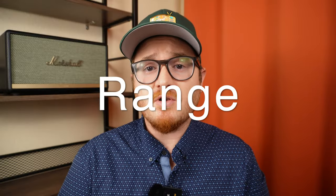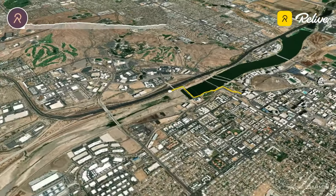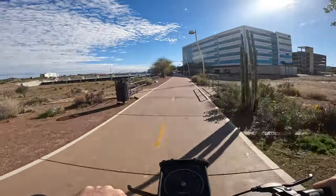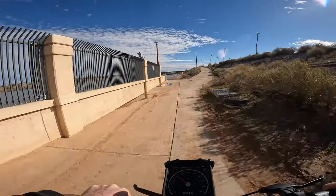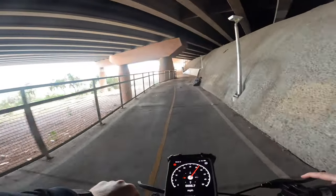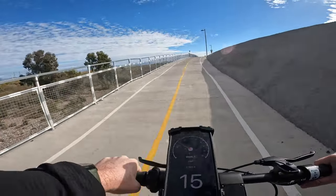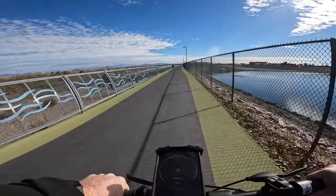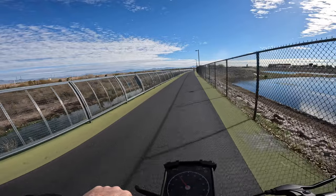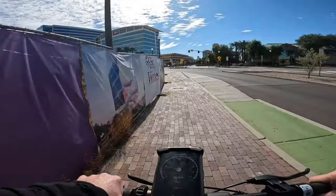In terms of range, Richter lists the max theoretical range for the S9 at approximately 40 miles. Keep in mind that range estimates are impacted by rider weight, riding surface, speed, incline, and other factors — in the real world you can typically expect 50 to 60 percent of the theoretical max. I tested the S9 on the bike trails in Tempe, Arizona in sport mode at 22 miles an hour and was able to get just over 20 miles of range, weighing in with gear at 205 pounds after lots of stop-and-go riding and several steep inclines. This scooter is also able to maintain over 20 miles an hour even when the battery is at 20 percent, though acceleration is noticeably lower at that level.